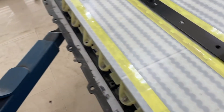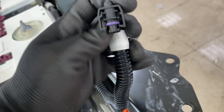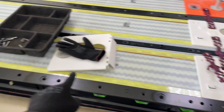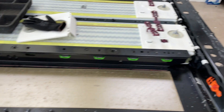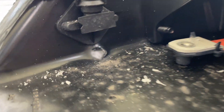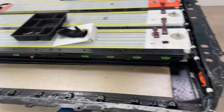The block is finally out. First you need to release two pipes which can be tricky - you can break those hinges. Second step is to release the high voltage bolt at 13 millimeters, then all the bolts in the middle. After that it's pretty heavy to take out. Now here we are investigating which brick is discharging from the bottom side. We can see traces of water ingress - the hole is here. This battery pack was damaged by external mechanical damage and water ingress.